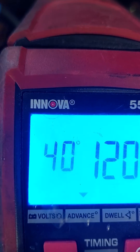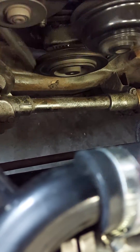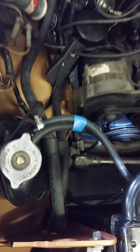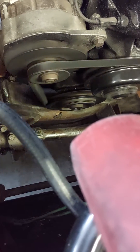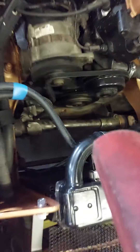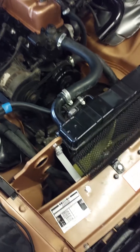And we're at 40 degrees. You'll also notice there's an amount of what I call spark scatter - that's when it's appearing on the pulley further down as well as the top position. But generally, it's on 40 degrees before top dead centre at idle. It's about 28 degrees out of where it should be. Let's just hope there's no damage done.